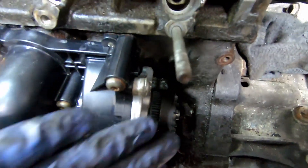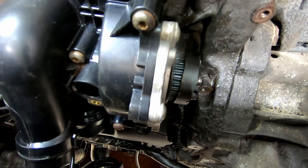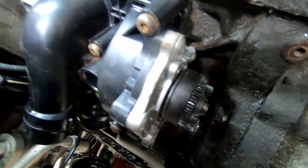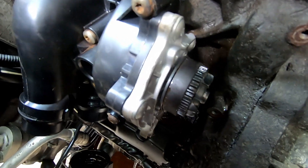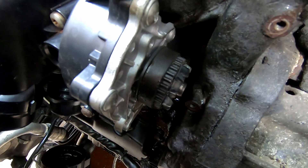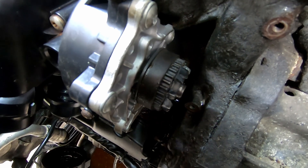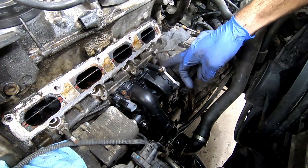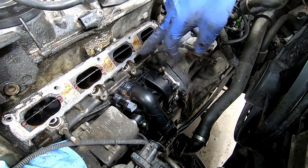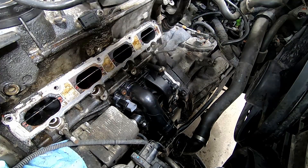The belt is a little crooked so I push it in by hand and close it up. The belt is now in the right place. If we turn the crankshaft, everything is in order. That's about the easiest way to do it — if you try to push the belt on mechanically you're going to have a very hard time. The belt's on, so let's close this up, attach all the hoses, and then I'm going to add water to the system just to check for any extra leaks before we close up the manifold.